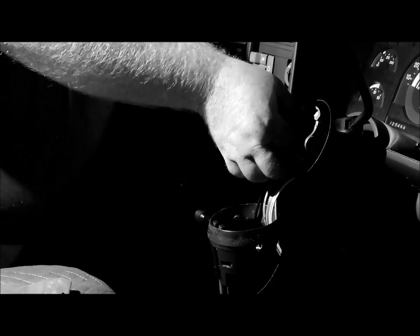And a lot of people have always been concerned that once this thing gets loose and goes to moving up and down, the steering wheel is going to fall off. And I hadn't necessarily ever believed that that's the case, but it's one of them things, if you keep running it, eventually those bolts will loosen up to the point that your turn signals will get erratic about working. Your automatic transmission shifter will get erratic about working.